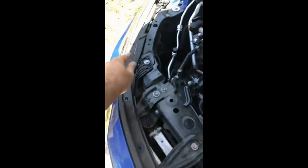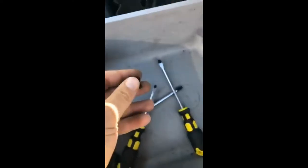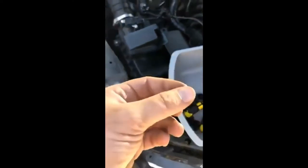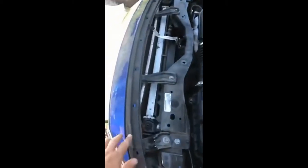My progress so far is I just got to pull this off and get these clips off. If you don't have the right tool for these little clips, just use a wider flat blade screwdriver, and I'd recommend putting some tape or a rag around the screwdriver so you won't chip the paint. Also take some pictures of how everything goes together before you take it apart, just to help with re-installation.